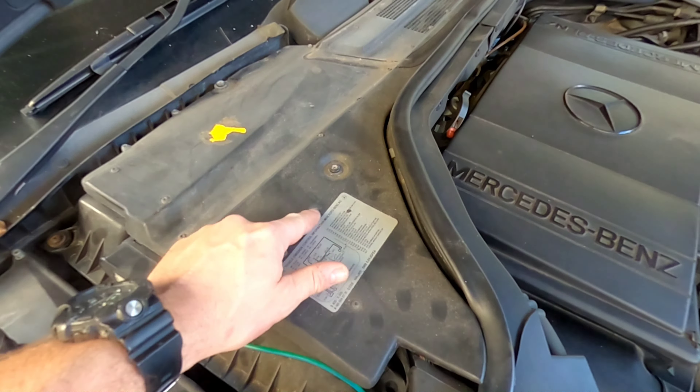We're going to put our negative here and tap our positive - and you can see our blower motor kicks on. That's good news, because the resistor is not enabling the blower motor to kick on, meaning something is faulty within the resistor. Signs of it going faulty include your AC not kicking on or your middle vents not working. This resistor sends various signals to your blower motor to control different speeds. It's the least expensive part to try first - after that you might move on to the control panel, removing the blower motor, or changing out the brushes. But on this video we're focusing on just replacing the resistor. We'll need a torx bit to pull this unit out - I'll give you the size - and then pull the wires apart.